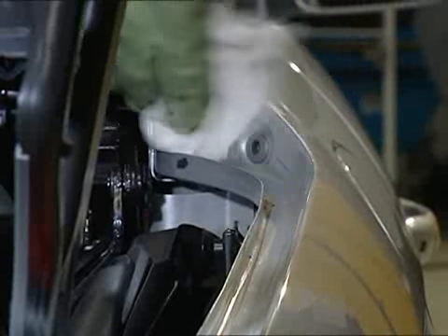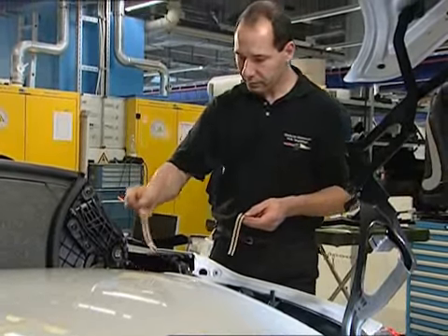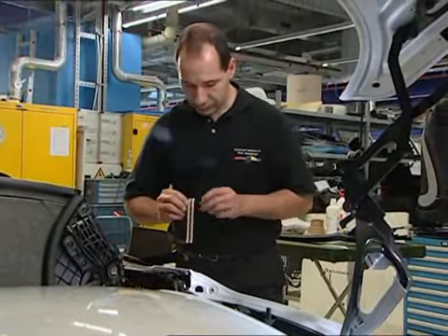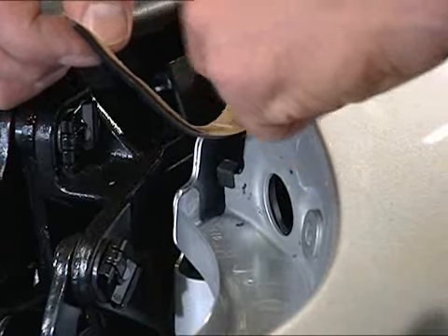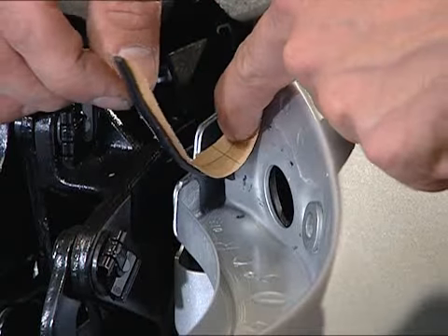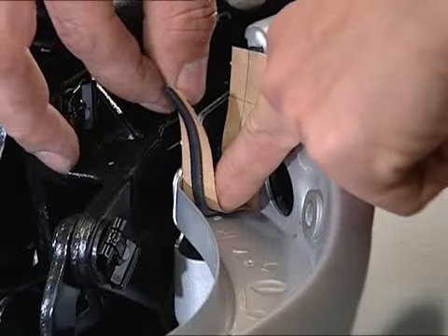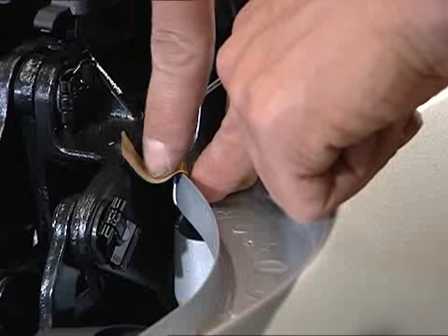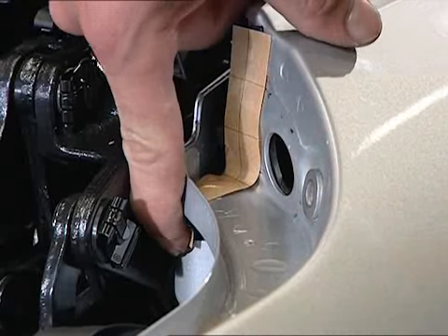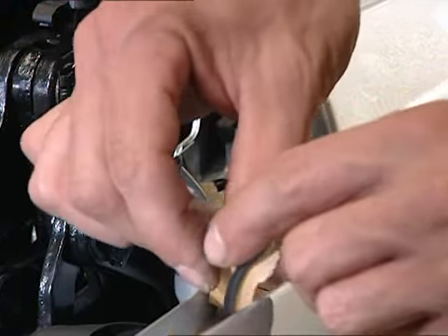Free the boot lid body shell flange of grease and dust. Place a 4mm butyl cord on the flange — firstly, diagonally to the groove and above the leaf guard opening. Secondly, along the flange base, fold one piece over the flange.